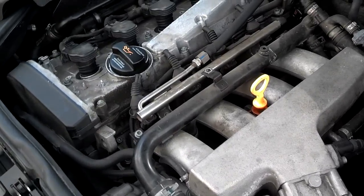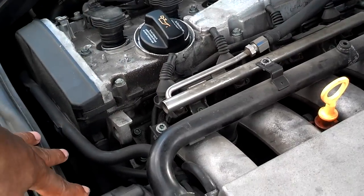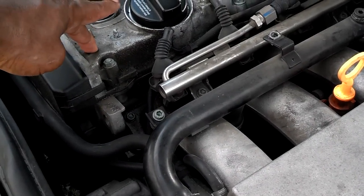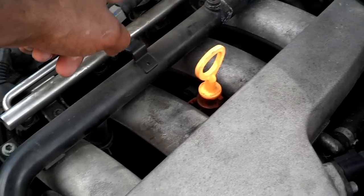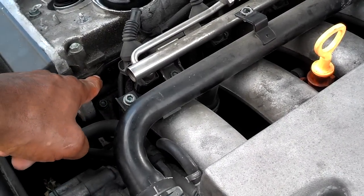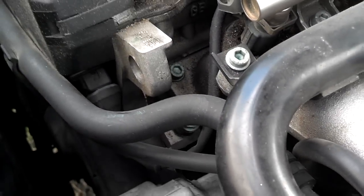What happens to the motor: once the motor overheats, the block is normally steel, which doesn't deform as quickly as the aluminum head. This is a head cover, and there's a line that goes along there. Some people call it the valve cover — it's the cover for the cams. Under that, you have the head. So the head starts about at this line here, and it goes down the motor until it meets with the block.